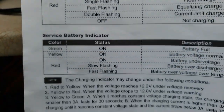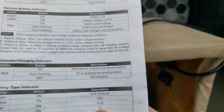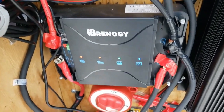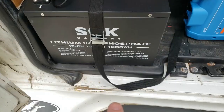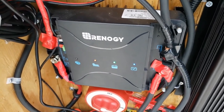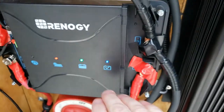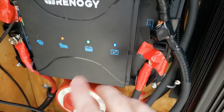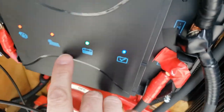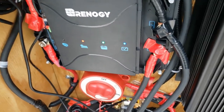When you go up to the alternator indicator, slow flashing means it's charging my starter battery. I'm sitting still, not driving, my house battery is full, and now it's sending power to my battery under the hood. I will never have to worry about a dead battery for starting my vehicle because this unit will charge it. Inside, this thing is smart — that's why I love it. When the house battery is full, it says we have more power coming in from the solar, we'll send it to the starter battery. And when that's full, it cuts power off to both batteries.